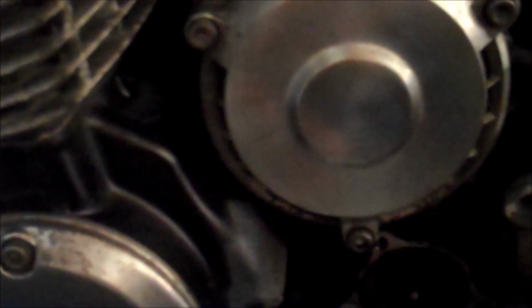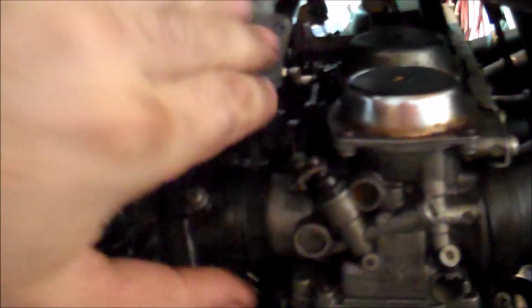And so you'll have little drippings out here, or it might drip in from a seam right here. So you can actually have unburnt gas dripping right out from your exhaust. So think about the entire combustion system involving the tank, petcock, fuel lines, carburetor, airbox, motor, and exhaust when trying to find that gas leak.